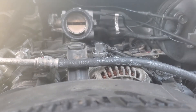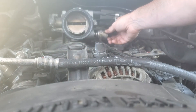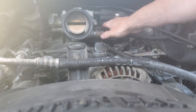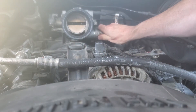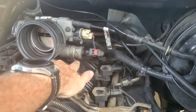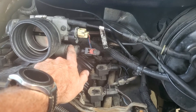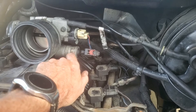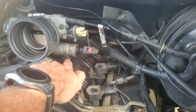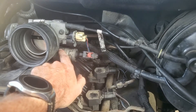To put it back in, just line up the hole here at the bottom with the hole over here at the bottom and just slide it in. There are two rubber gaskets so it's going to be a little tough to push in. I found it really hard to push this thing in, so what I did was I lined the bolt up at the bottom and just slowly started cranking the bolt down and it just pushed it in nicely. As it was going in I let back on the bolt just a little bit so it would go evenly between the top and the bottom. Just putting the bolt in was great and brought it back to flush.